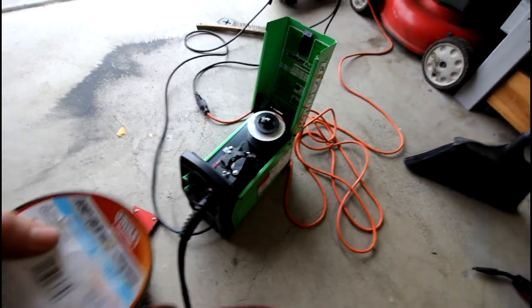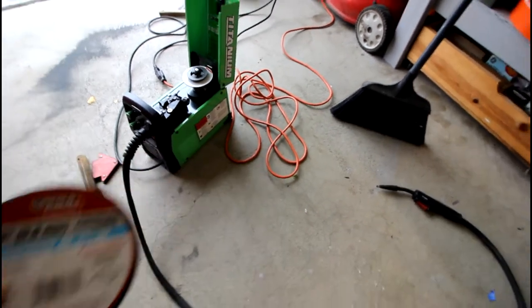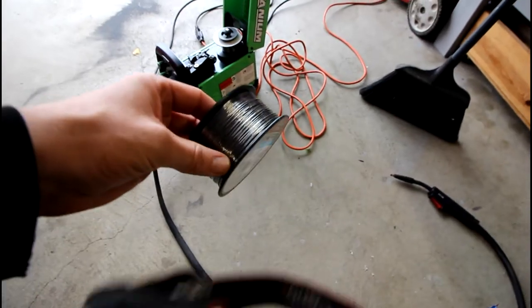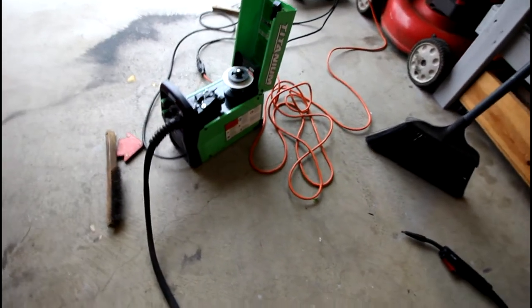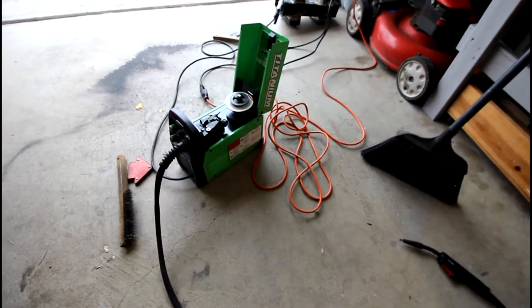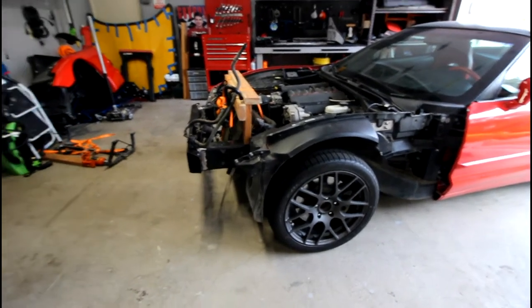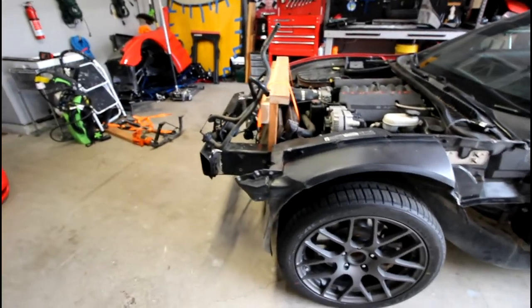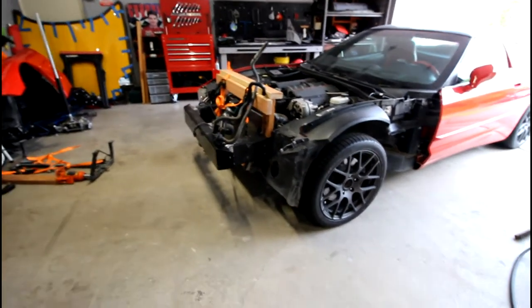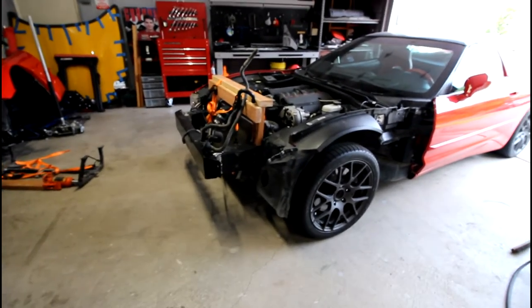One thing I want to note: in my previous video I was using the Vulcan 030 welding wire from Harbor Freight, but for these welds I bought Lincoln Electric 030 from Home Depot. I've read on forums that people like the weld results from this stuff better — it probably won't make a difference for my skill level, but I thought I'd try it. Also, I'm going to disconnect the battery before I weld on the frame rail since I'll be grounding to the frame rail. I don't want to take any chances with frying any electronics — just doing it as a precaution.